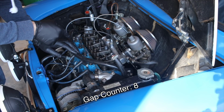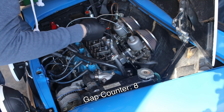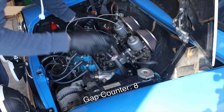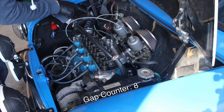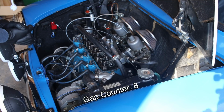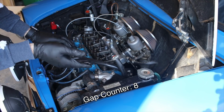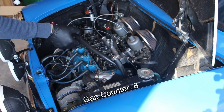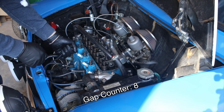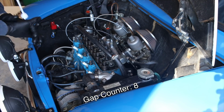So looking at this oil up here, it looks okay, except over here it's kind of foggy, and I'm wondering if it's coming from these breather hoses, because the oil that was coming through these in the past was kind of milky looking. And I genuinely am not sure if that's normal or not. So maybe you guys can tell me whether or not that's normal, because the rest of the oil looks perfect. I mean, it's the right color. As far as I can tell, it's fine. But generally, milky oil means something like coolant is mixing in with this. But I'm not seeing it in the rest of this, so I'm not quite sure about all that.